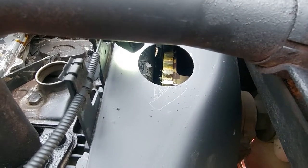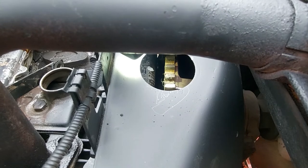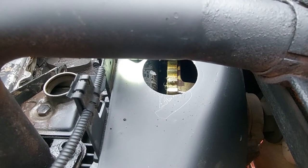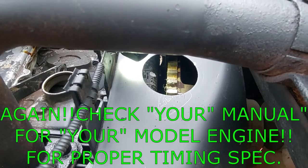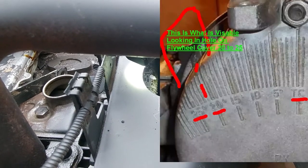There's going to be a couple of big slashes. Those slashes are five-degree marks, so the one that's closest to the center of the top of the engine — that's 20 degrees. The next big line is 25. You want to time at 21, 22 degrees, somewhere in there, so we painted that 21-degree mark. There are small slashes in there, and each one of those is a degree.